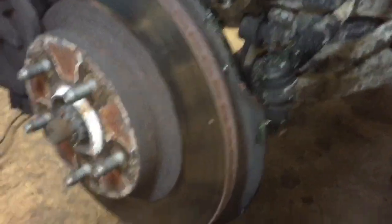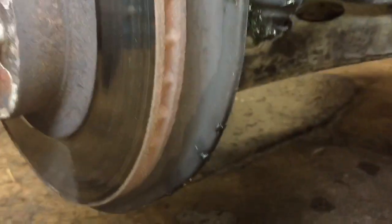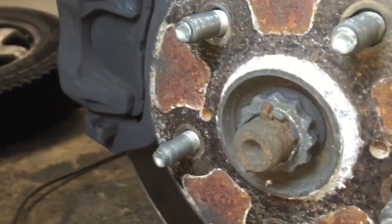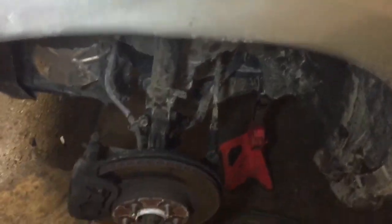We won't have the part till tomorrow, but we're going to start by taking off the tie rod end — just take off the nut, pull out the clip, use a hammer and tap it to pop it up. Then go for the lower ball joint, tap it, pry that up, take off the front nut and pull that out. Then get in there with a pry bar and pop it out, and the CV axle will be free. I won't do a step-by-step on camera but that's how it's going to go.